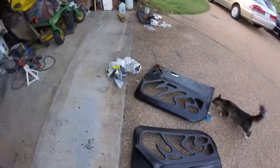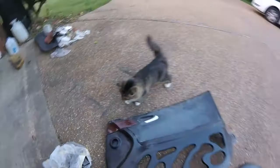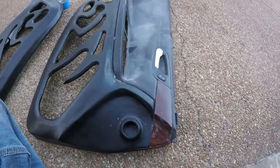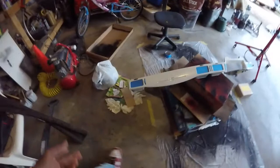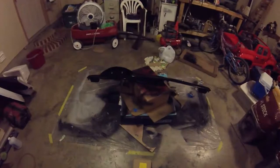Tape is off. Still got to clean all this off and dust everything down. Next up is painting this gloss black. I got to clean this off because it's the one I got from the junkyard, so it's still dirty. Same deal — wipe everything down, alcohol, wet sand, clean it. Then I can paint this gloss black to match the dashboard. Vents taped off, up and down knobs taped off. Everything is clean, dry, and ready for paint.